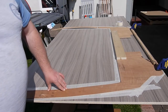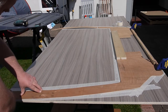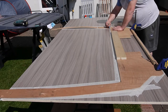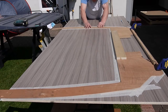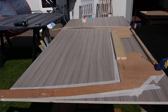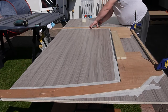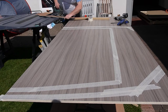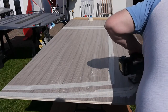So we've made this template out of the old door lining and pressed it up, and now it's time to turn it onto the furniture board. In the background you can see the bulkhead - we only kept hold of this for this one template. Once we had a rough outline, we disposed of it. We offered up this template a couple of times and during the process I actually managed to snap it, but it was pretty good so we just bashed on. I had to decide how long these side pieces were going to be on the panel, and I decided to keep them quite short. I offered it up in the van a couple of times, and once I was happy, it was time to cut it out.